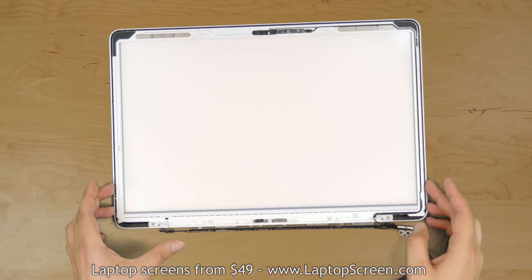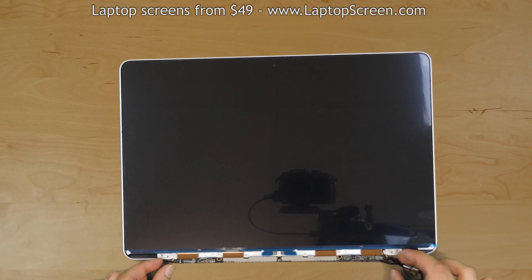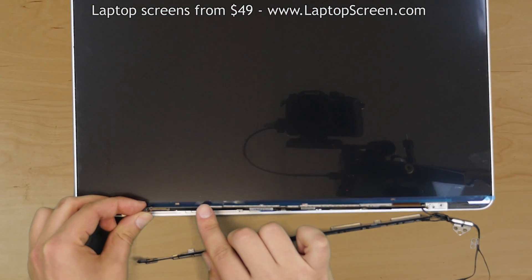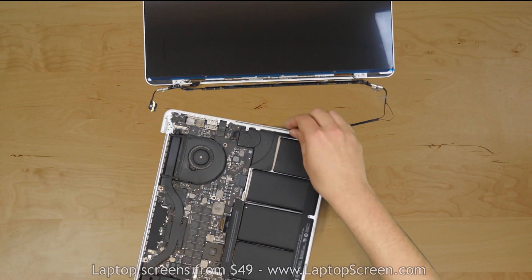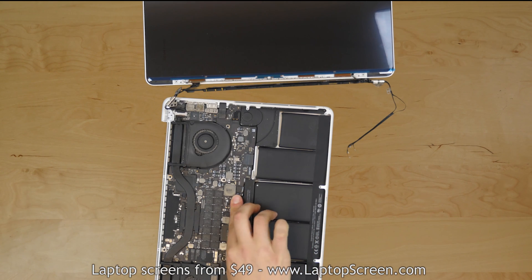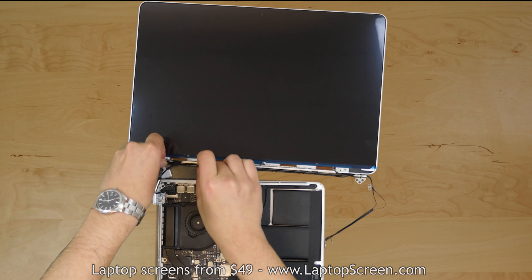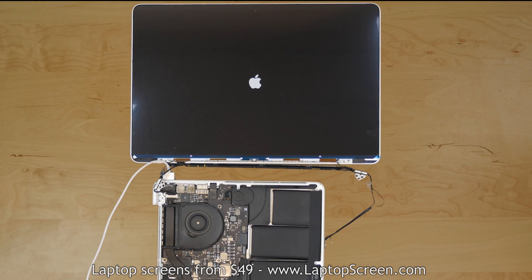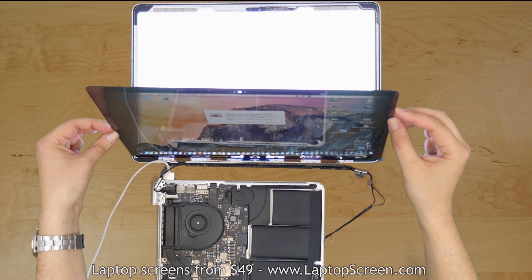Once the edge has been cleaned up, you can perform a loose test of the new part. To perform a loose test, place the new LCD matrix into the cleaned up assembly with no adhesive. Reconnect the old backlight connector to the new LCD driver board. Gently reconnect the video cable to the video port of the new matrix. Place the main body perpendicular to the display assembly and align the video port on the motherboard with the video cable. Reconnect the battery connector. Carefully reconnect the AC power. MacBook Pro Retina will not start without AC power if the battery has been disconnected, even if the battery is fully charged. The laptop should power on by itself. And as we can see, the new replacement matrix is working. Here is what the backlight looks like underneath the screen — it is nice and even. All LEDs are on.